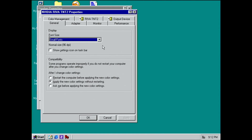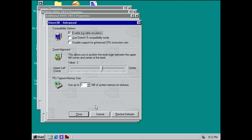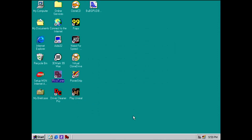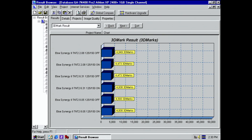Now we are ready to run some benchmarks. And here is where the trouble started with the drivers, particularly with the vSync option. The Detonator driver 2.08 does not allow control of the setting in the control panel. You have to use a third-party tool like RivaTuner, which you can see here. Under the DirectX options you have a tab dedicated to vSync. Unfortunately, this doesn't always work and there were some occasions where things just didn't behave as expected, but I had the best results with this tool. When we look at the 3DMark results, we can see that drivers 6.31 and 8.05 score higher with vSync enabled compared to vSync disabled. For driver 2.08 it is the opposite.